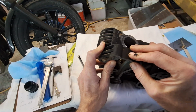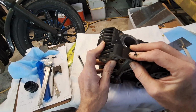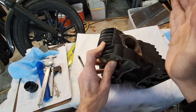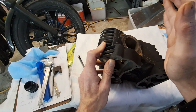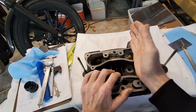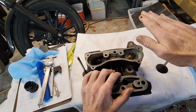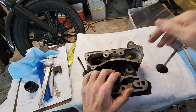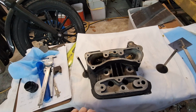What they're looking for is packaging. They're using a shared manifold or inlet manifold, intake manifold, and their carburetor's always sticking out the right side there, or induction module, whatever they're using, because that's a look thing. So packaging is kind of important. On something really good, a better setup would be intakes coming straight up with downdraft carbs, or fuel injection that's pretty much straight up and down there, which, because of their frame design and engine design, just isn't feasible as far as aesthetics go.